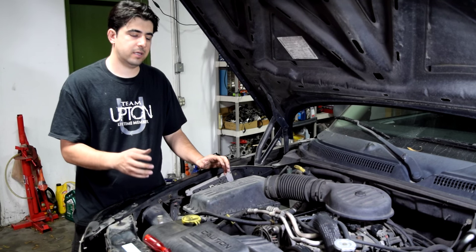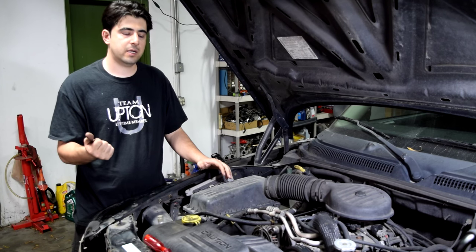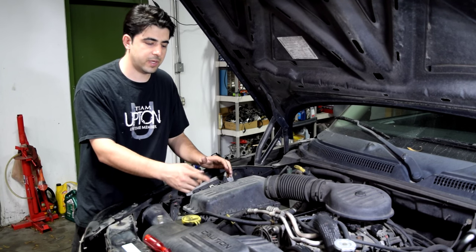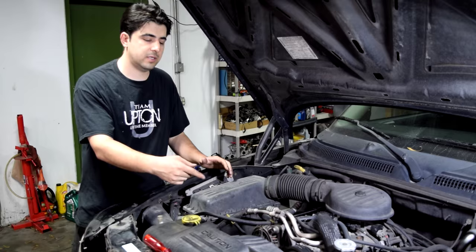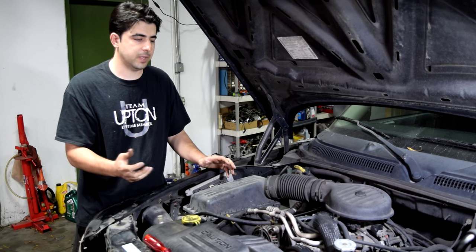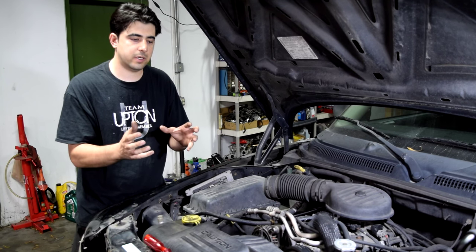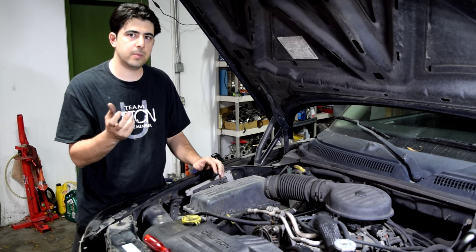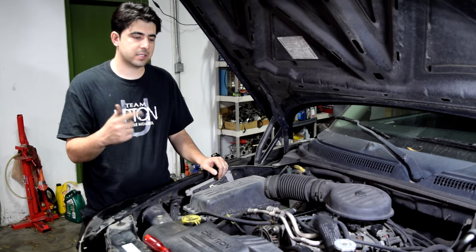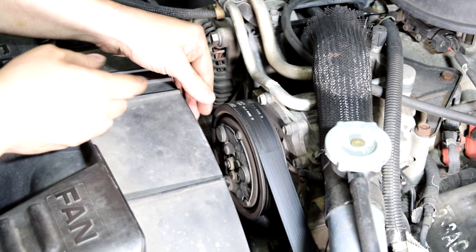Now with the symptoms we have — noise going up and down with the RPM, and the noise being more pronounced with the compressor clutch engaged or when the car is in gear — it usually means there is a problem with one of the pulleys or the bearing for one of the components up front that is controlled by our serpentine or drive belt. The reason we hear the noise more when the car is in gear is that the engine vibrates more in gear, and that vibration causes a bad pulley or bad bearing to wobble more and make more noise. There's also extra drag on the belt in those conditions.